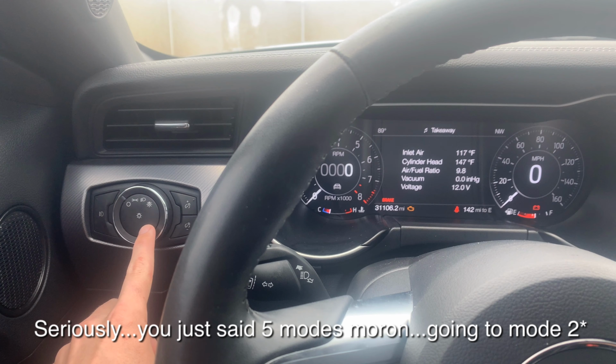Basically, what you're waiting to see is just like with any other ceramic coating, once you apply it, it's gonna start to get a little haze, almost like a little rainbow kind of effect. It's kind of similar to how wax works when you put wax on a car. Once you see the haze or the rainbow effect, you know that it's good to begin to wipe it off, because this isn't something that you just wanna wipe on and leave on, because it will cause streaks. So I see my haze starting up over on this light over here, so I'm gonna go to town getting the ceramic wiped off. And then we're gonna let these sit and cure for the next couple of hours. And I'll probably end up doing the installation on these tomorrow morning.